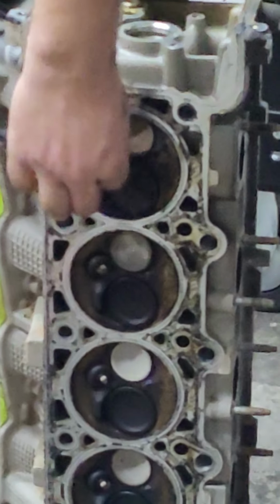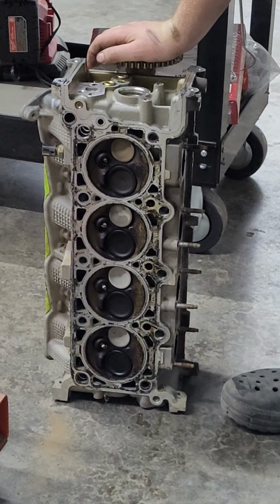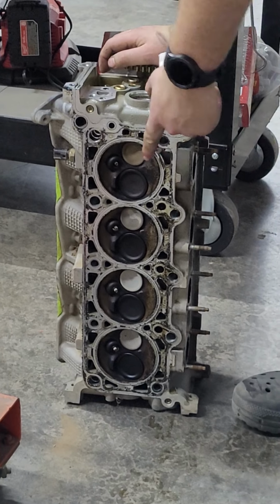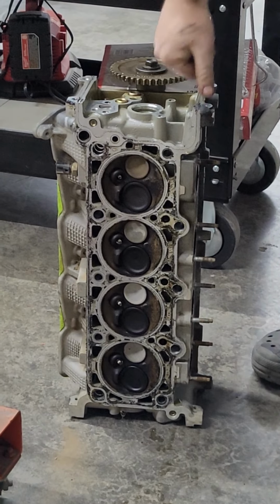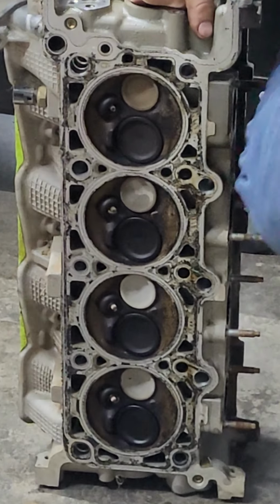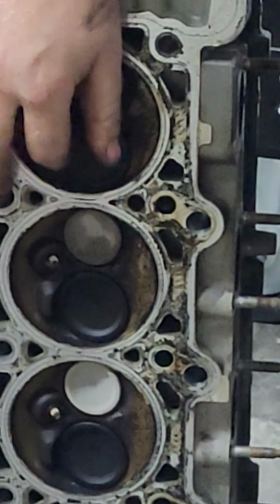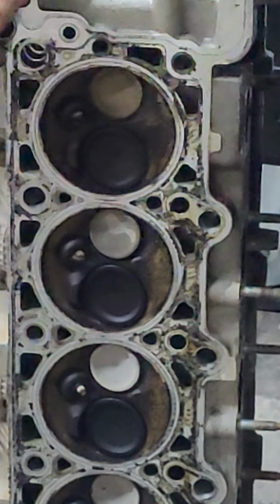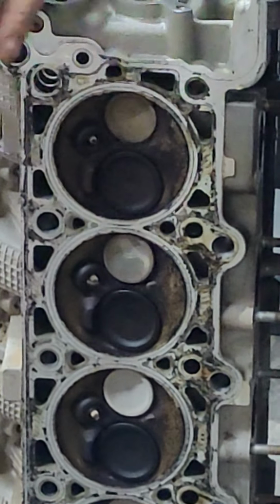Heads are pretty clean. Yeah, we never did pull up the spark plugs. It's a much bigger chamber than the 4-valve. It actually isn't. So these are 42cc or 43cc. Those were the 2 factory chambers. I think these are 42cc, although we might take that swirl dam right there out, to unshroud the valve, or at least take it back a little bit. I don't know if I want to do too much chamber work, though, because we're not going to change the valve seats on these, I don't think, unless we discover any damage.